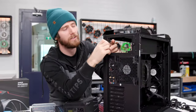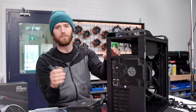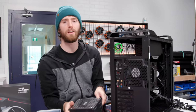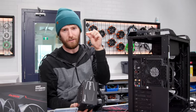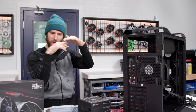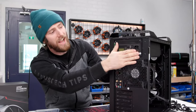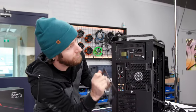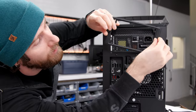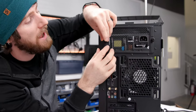I mean, there are so many factors when it comes to making a case design like this cost-effective. It can even be what's the standard size of sheets of steel, so that it can be cut most efficiently and you have as little wastage as possible. So maybe making every case 1 millimeter taller would have made it so that they would have wasted a big hunk of steel at the edge of the sheet like this instead of, you know, this or something. You never know. There's almost always a method to that type of madness, is what I've learned over the years working in this industry. You go, why is this screw ever so marginally shorter than that one? Well, because it saves 4 cents per unit, and when you sell a million units a year, that's like 40 grand. Okay, yeah, fair enough.